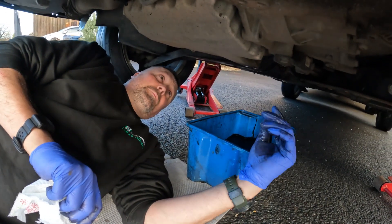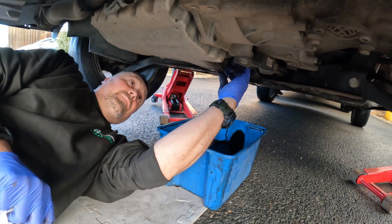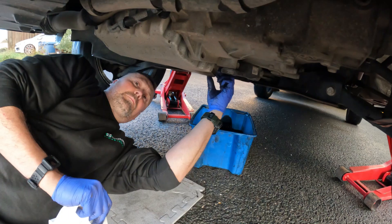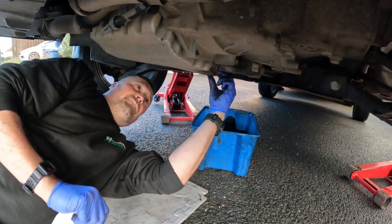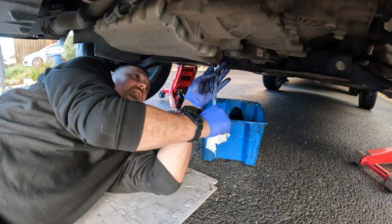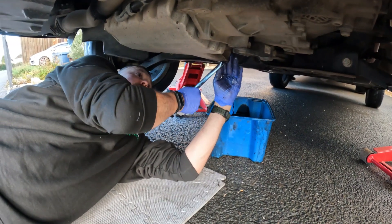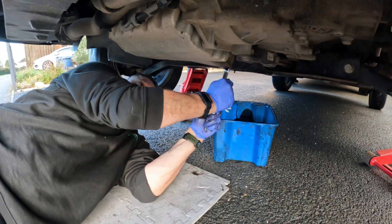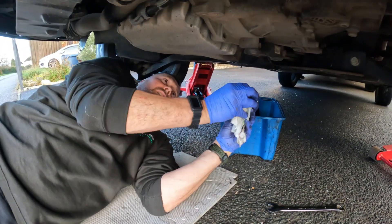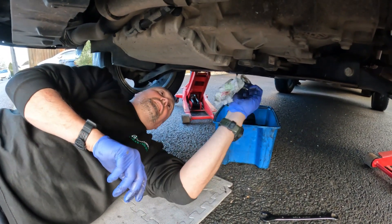She's all dripped out. Put a new washer on your sump plug and then wind it back in, all the way in. I always treat a sump plug like a spark plug — get it so it's all the way in, wait till it stops, it goes tight, and then just a good firm tweak. Don't go mad because you can rip the threads out, but it's got to be tight. And that's it — clean it all off.